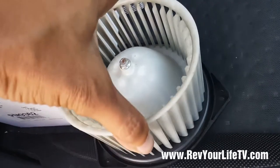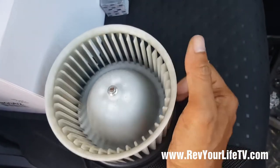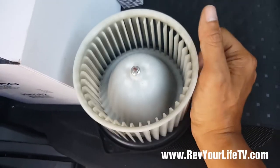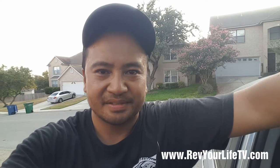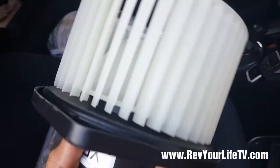Here's the old one. It doesn't move as easy, so I have to put a lot of effort into it. As a result, it shorted out the resistance box with the heat sinks on it, so I have to get a new one. Here's the new blower.